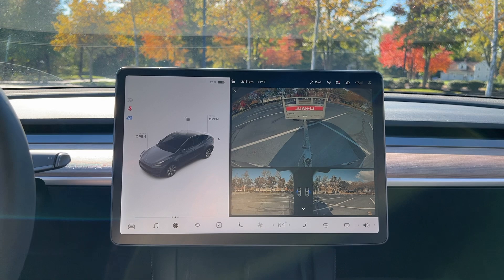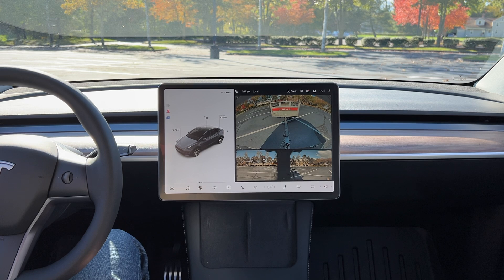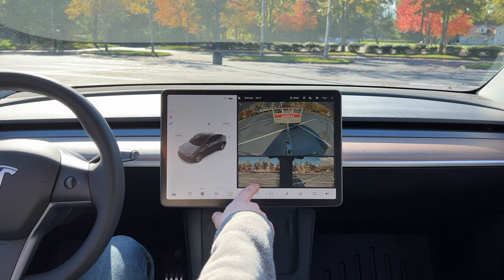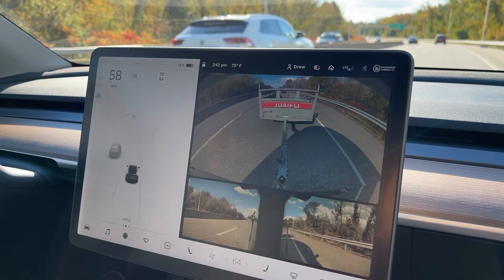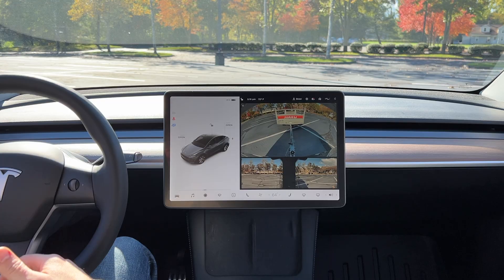Once trailer mode is enabled, you have the side cameras to check your blind spots — you can see pretty far back. Interestingly, both in the side cameras and interior mirrors you can't really see this trailer since it's relatively low and long. So make sure there are no cars around you. As shown in the driving footage, you want tons of space, be aware of your surroundings, and leave plenty of braking distance since stopping distances increase significantly with a large, heavily-loaded trailer.